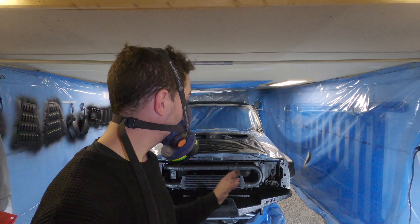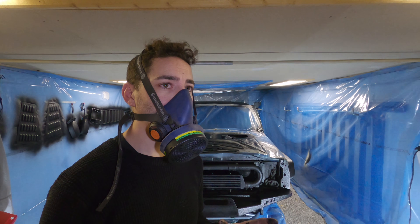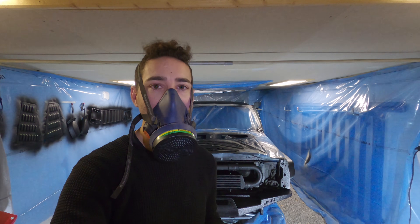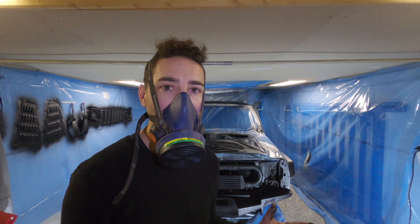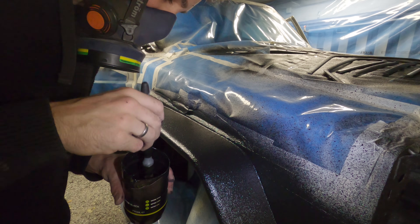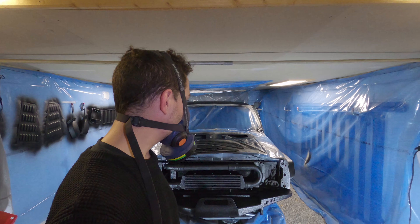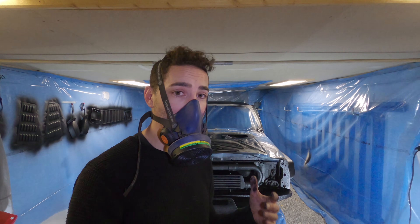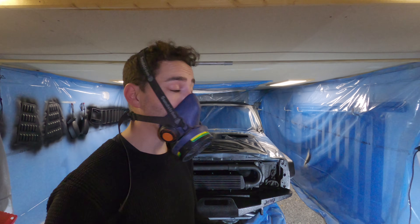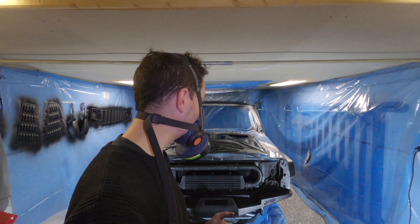I've gone over the whole vehicle with the little brush and what was left over in those three bottles, and it's amazing all the places you miss. The problem with the structure you're painting is there are lots of crevices and corners, and to get the gun into those places you end up layering the Raptor liner in areas you don't really want it layered. So just having a little brush — wait 30 minutes for the Raptor liner to cure enough that you're not going to disrupt the pattern, then go around with the brush, use the rest of the paint, and you save so much.